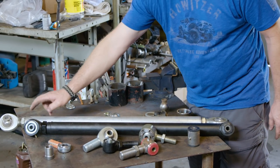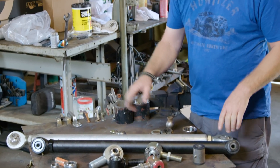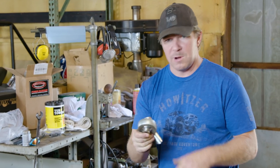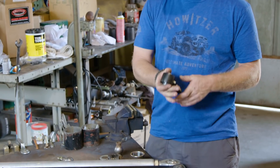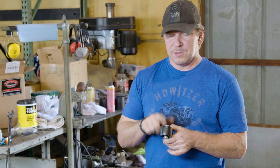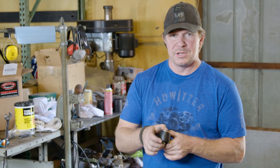Curry and BDS — I think the cases are both forged. This is a great kind of middle-of-the-road joint because it's between a bushing and the high-end heim joint or rod end. When I say middle of the road, that doesn't mean they're not really good. I've seen these in race trucks, like the stock mod class of King of the Hammers and desert vehicles. They can take a lot of abuse because they're a mixture of a bushing and a fully forged housing. They work really well and they're not as prone to transmitting shock loads — there's a little bit of cushion in there.